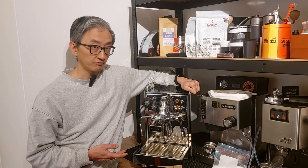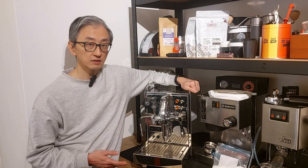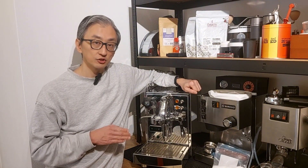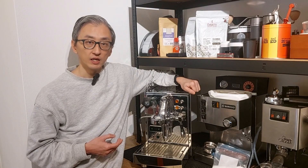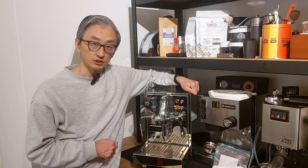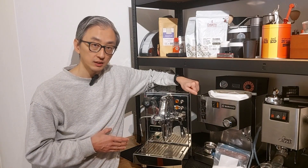I tested citric acid here and it went totally fine. I already brewed some coffees and tasted the water after descaling — no smell or taste of acid. Also an important clarification: Cafiza is only for back flushing, not for descaling. Cafiza is a detergent, like soap in a washing machine — it cleans coffee oils from your group and discharge valve. You can also use it to clean filters and puck screens, but it's not intended for the water tank or boiler.